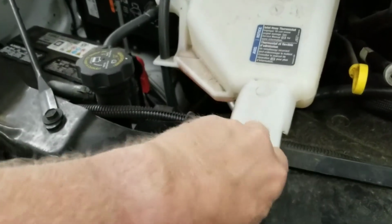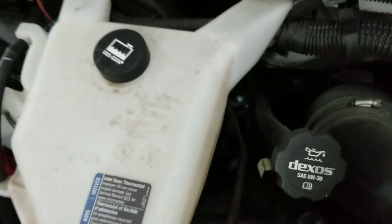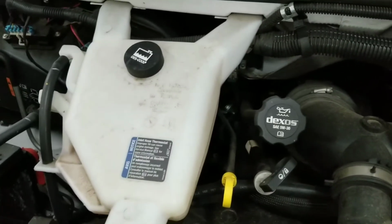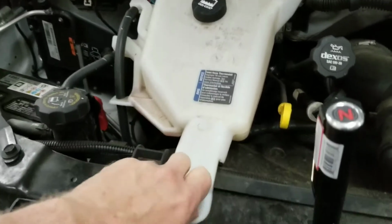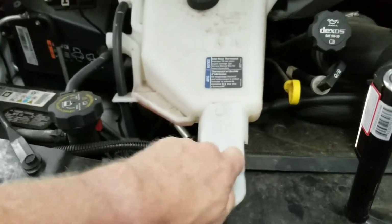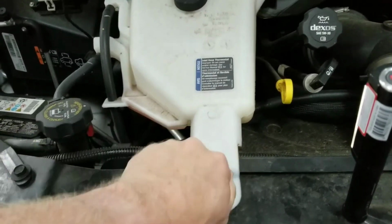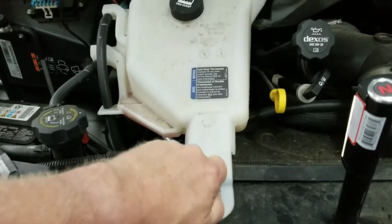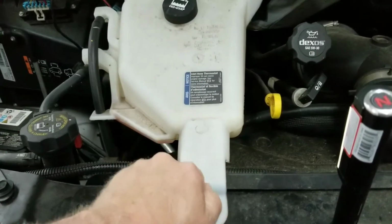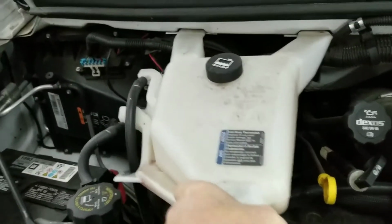Like I say, this will be interesting if I can pull all of this off, because then I've got to climb underneath this van. This is a 2015 6.0-liter motor. I'm going to have to get underneath there with a 3/8" socket wrench and pull the belt tensioner, so I can get all those pulleys to come around it. It's going to be quite an adventure. I know you're just dying to see me finally get that thing out of there. So essentially that's all we do.